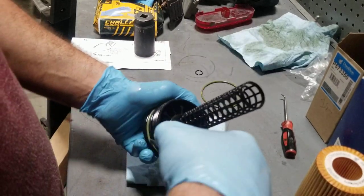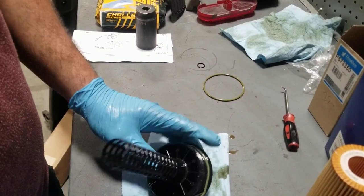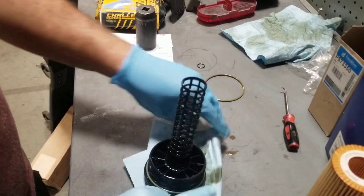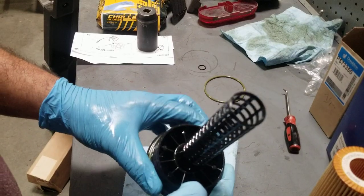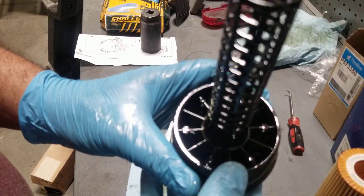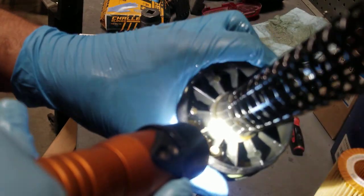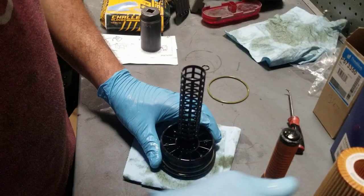I've got the new o-ring — they came in a kit. A trick an older gentleman taught me is to put a screwdriver under the o-ring and go around it, so that if your o-ring is turned, it centers it and sits a lot better. That gives you less chance of it getting kinked, ripped, or causing another leak. With the filter housing off, you have to clean out the inside because you can see a little bit of brass from the synchros — which is kind of normal, since when shifting the synchros wear slightly. You have to clean that out and throw a new filter in.